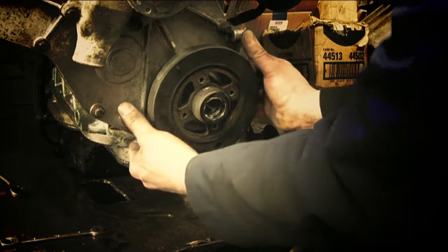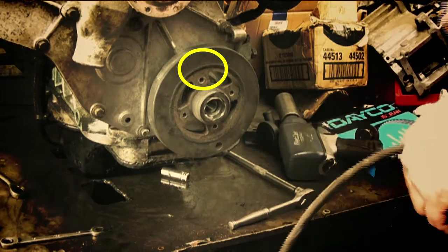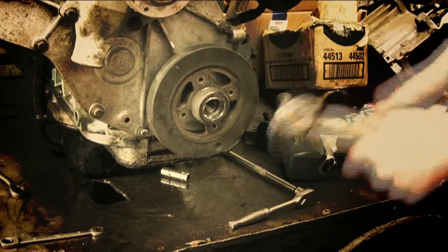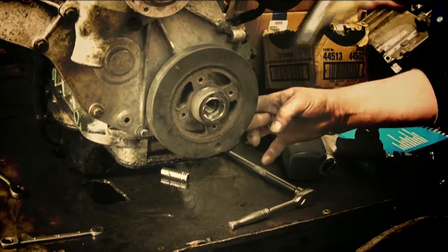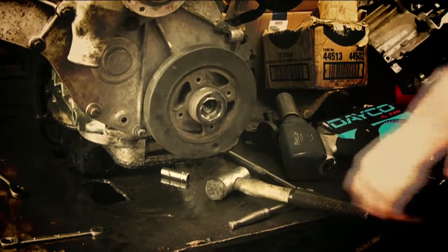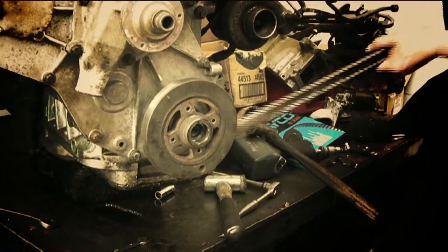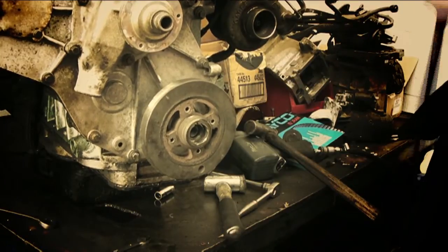Here is a rubber section, and I'm going to explain why this is such a hassle — especially using a hammer or a bar on that section will hinder you from pulling this properly. You can see the four bolts on there from where I can put the puller into. Using a bar, you could possibly get more leverage on a more solid part, but you're in danger of smashing the timing case front cover.